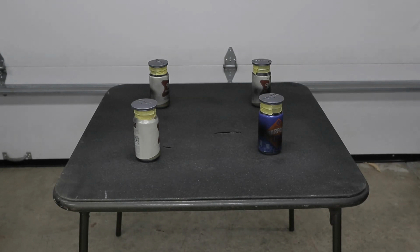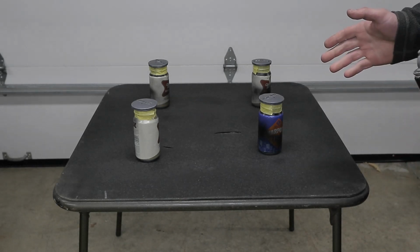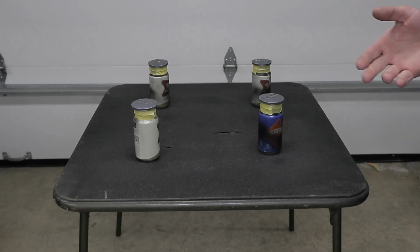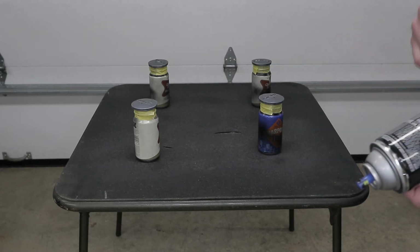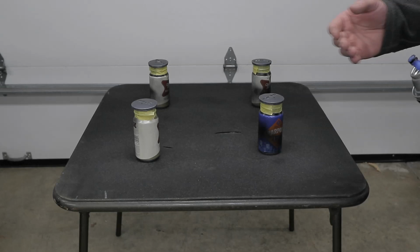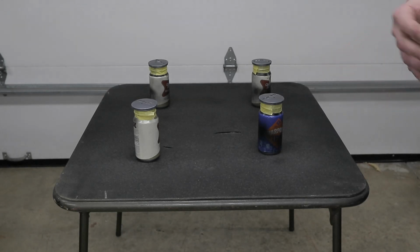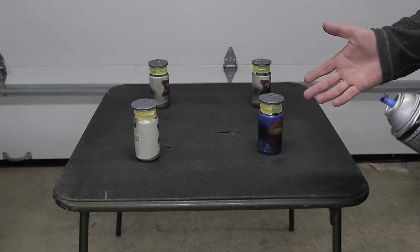All right, so the first coat is going to be a light coat, so that it adheres to the surface. Once that's dry, about 20 minutes later, I will come in and apply a second coat, which is going to be slightly thicker, because I want to get a nice glossy, thick, wet look. This is going to dry to a satin finish, but you want to apply that second coat wet looking, and make sure the whole surface is consistently wet looking. That way when it dries, it will dry to a consistent thickness and look without any blotchiness.